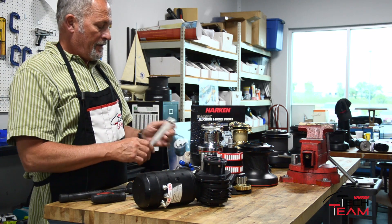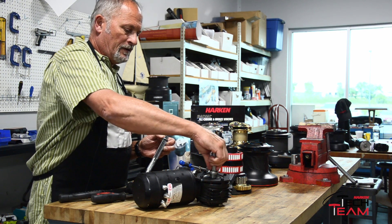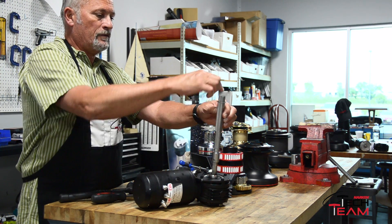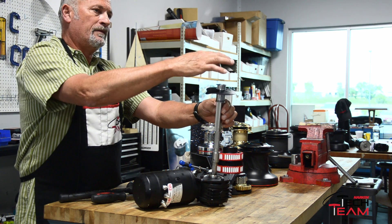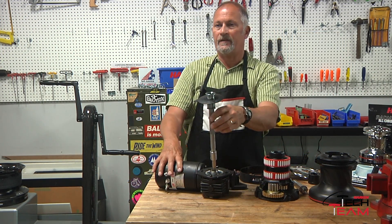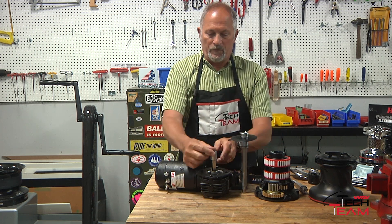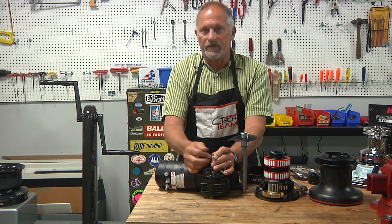All electric winches have a disconnect rod in case you lose power or want to use it manually for racing. There's a straight pin that goes all the way through — when you put the locking handle into the handle socket, the pin depresses and operates a mechanical disconnect below. If you're going to race, we have a racing disconnect rod so you don't have to fight the spring tension every time you put the handle in. It permanently bypasses this, so you physically screw a different pin through to disconnect it for racing.